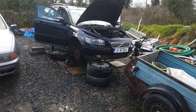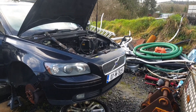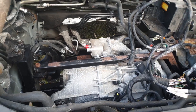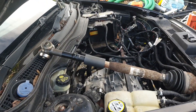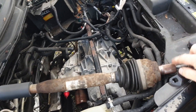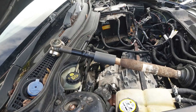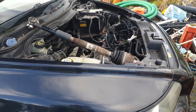I've had quite a few questions about the Moscow recently. Haven't done a whole lot over winter but have been making some inroads, and hopefully sometime later this year we'll have this motor running and spinning wheels. We've been doing a little work on the drive shafts — this is the driver's side drive shaft with Volvo on the outboard end and Model 3 on the inboard, coupled with a 3D-printed shaft coupler in PC carbon fiber.